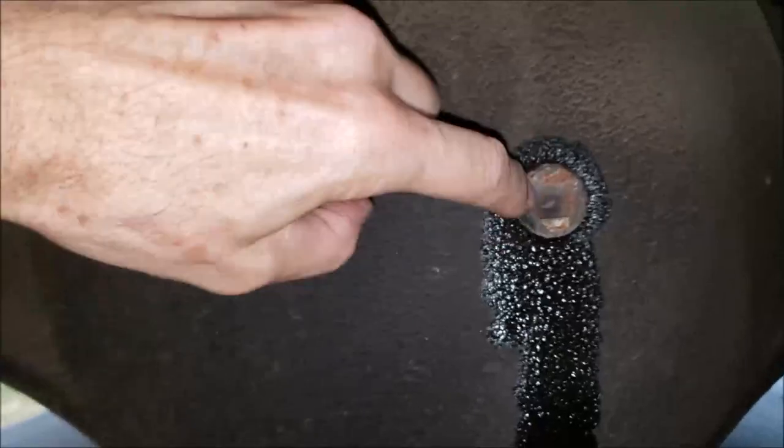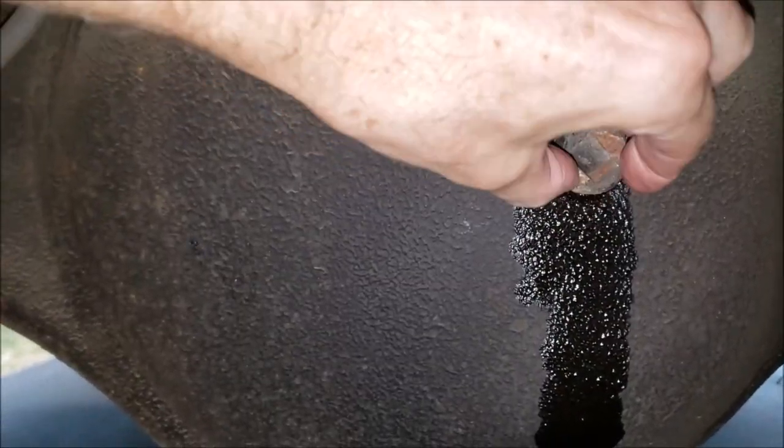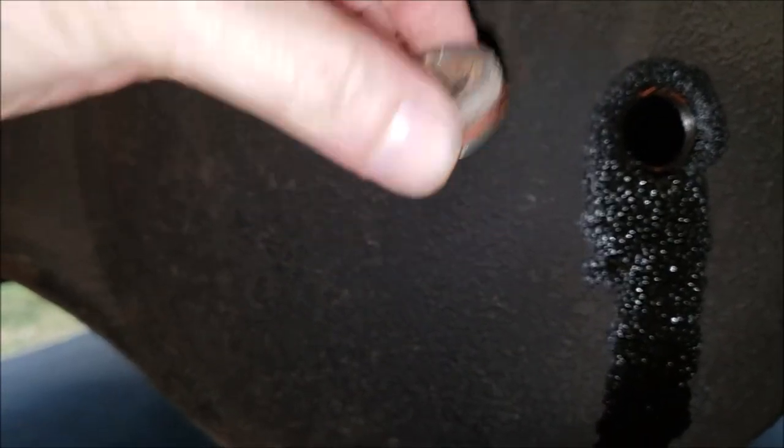All right, let me take a little light on the subject. Here's the oil fill plug — I took it out already. I was kind of surprised there is no magnet on this. I don't like that. I might see if you can get another plug that actually has a magnet on it. We'll take the bottom one out — maybe it's got the magnet on it. It's about an inch low. I put my finger in there and there's no oil, but it's also black as coal.